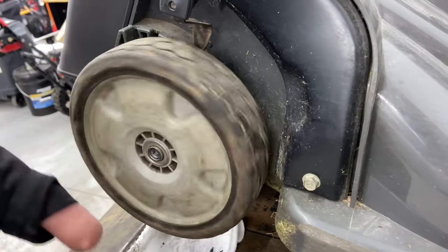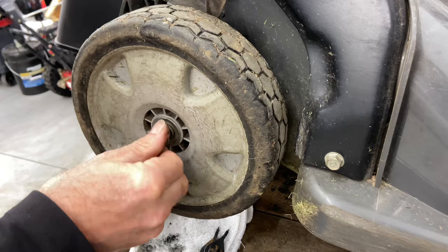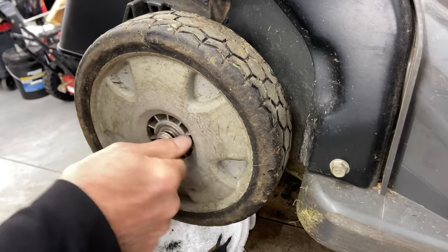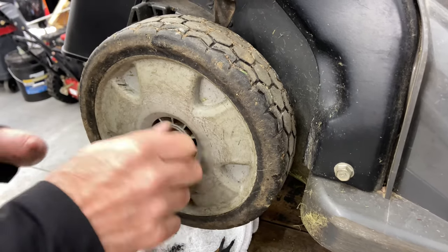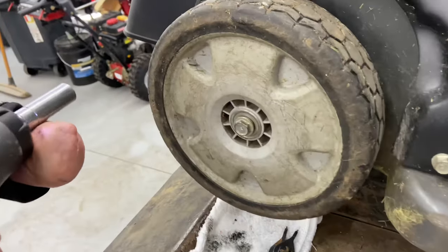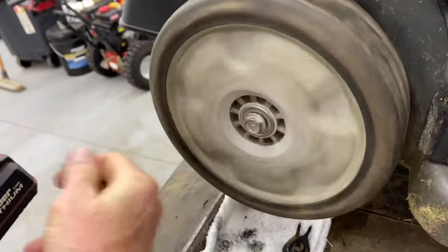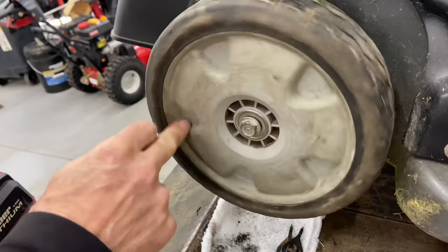You see how it got quiet? It's still clicking, but a lot quieter because now there's grease in there. Make sure it locks in to confirm your key didn't drop out. Then you have the washer that goes on this side and then your snap ring — our snap ring is in good condition. Put it on and make sure it's seated properly. Then double-check your wheel to make sure your gear is not loose. Go ahead and slide the wheel back on. Now it's a little bit quieter, but after your first cut it's going to be probably just as loud. But now we know we have sufficient lubrication for most likely a year.